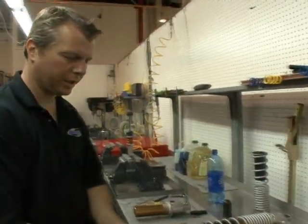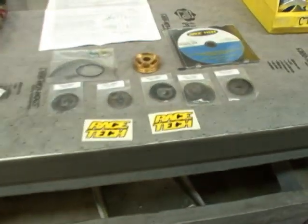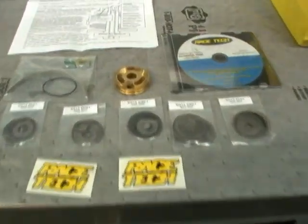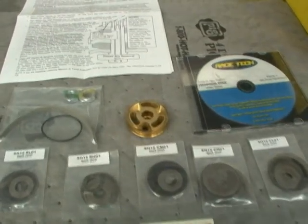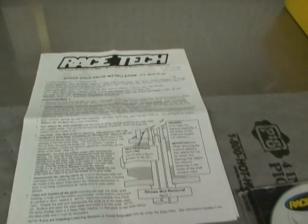The sport series is basically external work where you won't have to disassemble the shocks. If you get into a gold valve kit — which is what we have right here — it's an internal piston assembly where you're getting a valve body and only the necessary valving shims. This is going to be more involved and will require disassembly of the shock. These kits come with full instructions and a video. It's not the easiest thing, but you can do it in your garage. It will require an investment in some tools and a nitrogen tank, but any reputable suspension shop can install it for you.